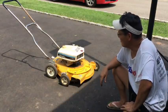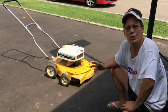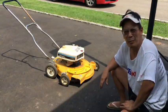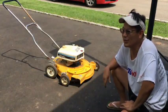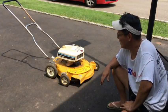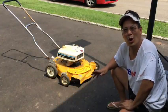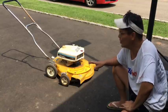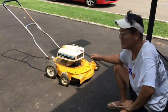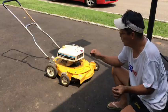So this was my International Harvester, my very first one, my very first two-stroke lawnmower. And I mean, it was kind of a pain in the butt to work on, you know what I mean? Especially with 95 degree heat, and it's not comfortable, but I didn't think I would get this going, to be honest with you. And it didn't really take all that long. It was very interesting to understand the linkages on the inside and how everything worked. I did replace the primer hose because it was too short and very hard and brittle. So I swapped it to a longer one.